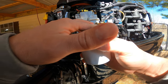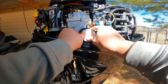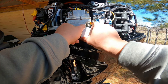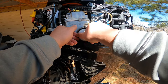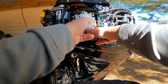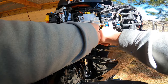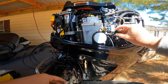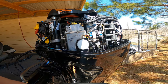Until your filter fills back up with oil and recirculates, it's good to put a little oil on there. Again, take your time and make sure you don't cross-thread anything. When you put your filter back on, once your gasket makes contact and you've got a good seat, just hand tighten — there's no need to torque that up. It's going to get a little tighter as it heats up. Then lock your dipstick back down and we're going to go over and refill the oil.